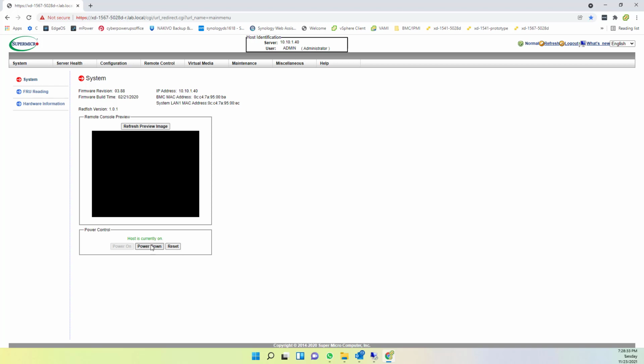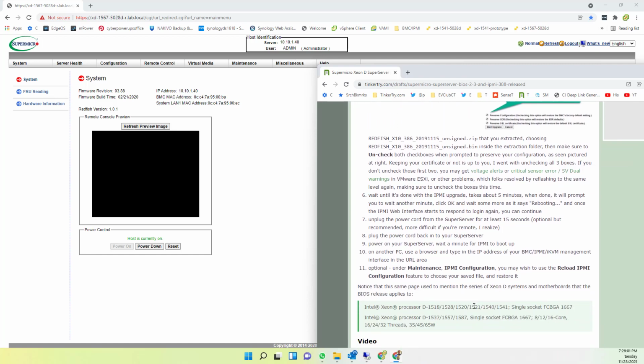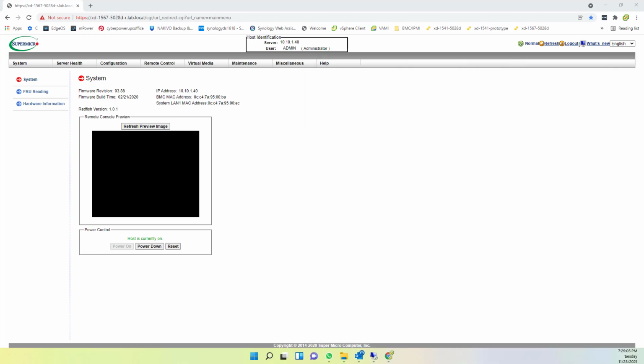So at this point, I'm going to stop recording the video since this is the machine again that I'm powering down. After gracefully shutting down Windows 11, which is running in this machine, I'll unplug the power cord, waiting at least 15 seconds, like I say here in the instructions. Plug it back in, power it back up. If I had any IPMI custom settings, I could have restored them, but I don't have any. So thanks for watching.